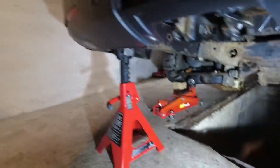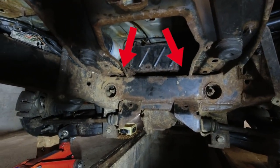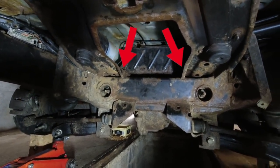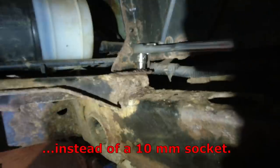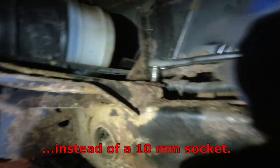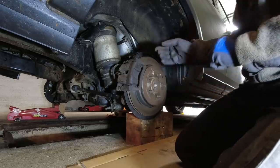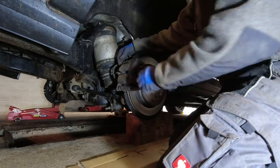I got these bolts out here, which nobody else got out so far. Soaked in WD-40, and one more to go. I got the 3/8-inch socket knocked on with a hammer and they actually loosened, believe it or not. I can take them out — just hard work. To take the brake caliper off I need a 13-millimeter ratchet wrench and a 15-millimeter.